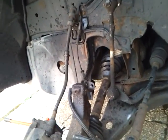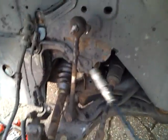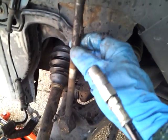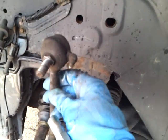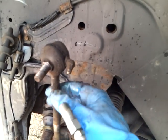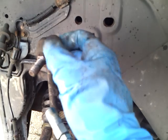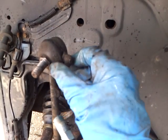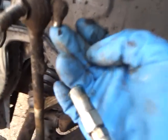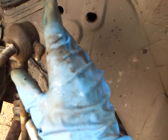In this video I'll show you how to grease your front end with the grease gun. This is a 2001 Ford Escape. This is the stabilizer link over here and this is a little ball joint in here. Usually when you see Zerk fittings like these, that means you can grease them. Sometimes they don't have them and they're sealed, so you don't have to grease those.